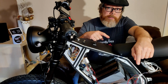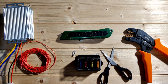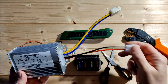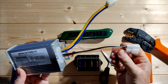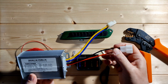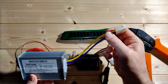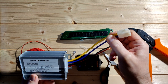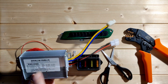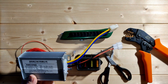Let's go back in time and see how I wired up the fuse box. We've got the 12 volt adapter — 72 volts coming in on the black and red, and 12 volts coming out on the blue and yellow. The higher voltage coming in is actually a thinner wire than the wire coming out, because the lower the voltage, the more amps — so you need a thicker wire coming out. This converter is rated at 25 amps, so you can have a thinner wire on the high-voltage input side but a thicker wire on the output.